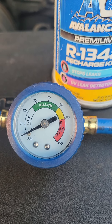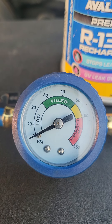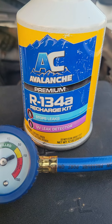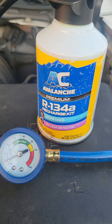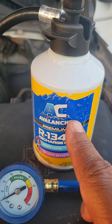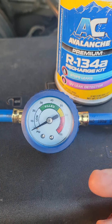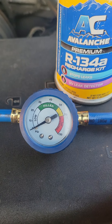But for example, let's say you're reading between 10 and 30, which tells you that you're very low on Freon and possibly have a leak. What you want to do is get yourself a can of Freon with a UV leak detector in it — it's nothing more than dye. Some cans come with their own attachment. Start the vehicle, turn the air on the highest setting, and add a half can only of this Freon with UV leak detector first. Your objective is to bring the system up to about 40 PSI. Keep in mind that some larger vehicles may have a slightly higher PSI rating.